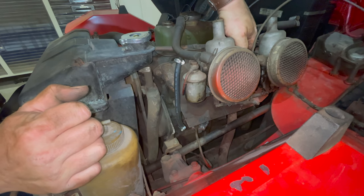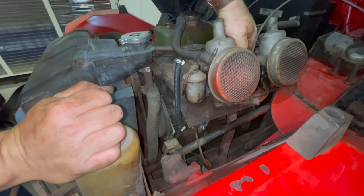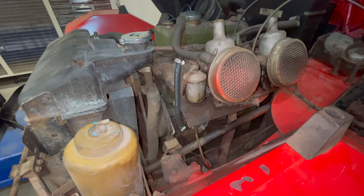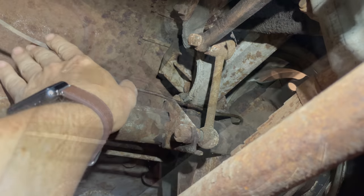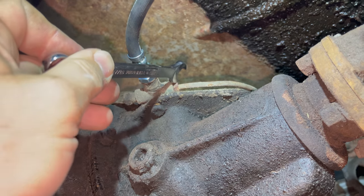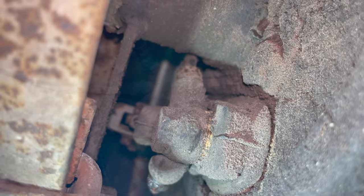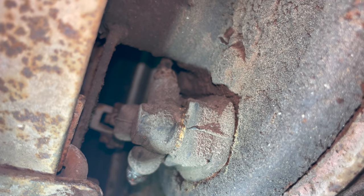Sounds like the fuel has made it to the engine. Now, if you remember from the last video I blew the brake line up here — you can see it's all wet right there still. I'll pull this off and make a new line. On the inside end, it connects to a T-intersection here on the rear end. It looks like someone has replaced this before because the fitting should take a 7/16 wrench, but this is a smaller fitting. The other end connects to a banjo fitting at the wheel cylinder, so I'm going to remove the bolt on the banjo fitting to pull it out.